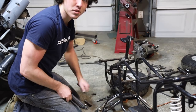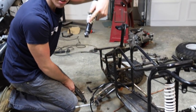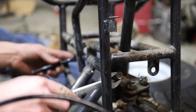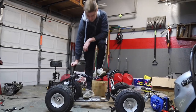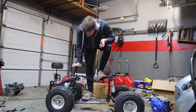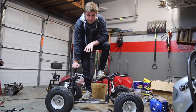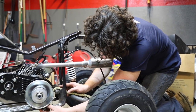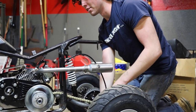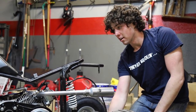I've welded up everything — the rear is completely assembled and now I'm putting the front end on. You can adjust the rate of these springs by turning the little silver part, so we turned it to full stiffness because it was bottoming out before. We got all the suspension stuff back on — it's a lot stiffer now but still has a ton of flex. Now putting on the Go Power Sports gold pre-stretched racing chain. We're not going to try to drive in this video, but I wanted it on so we can see how it looks. We got the gas tank and engine in — once I get this chain on we're going to try to fire it up.